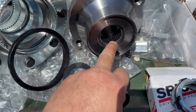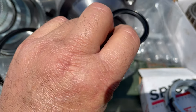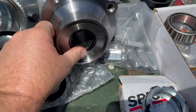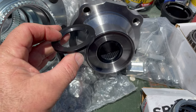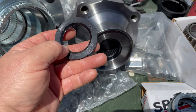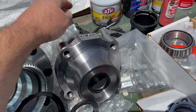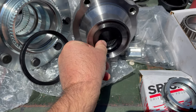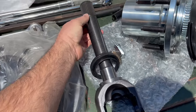Once you get to the point where you pack these bearings with grease, put a little grease on the inner lip of this seal and then this just pops in here. You could do the same thing by loading it onto the axle stub. See how it's got this bevel — that's a chamfer. That's going to go toward the center of the vehicle. So if the wheel's out here and the stub axle comes through here, then this will install like that. Here you have the 35-spline stub shaft.